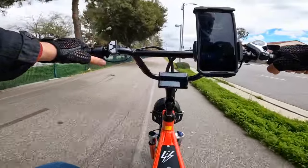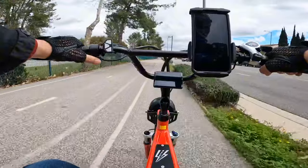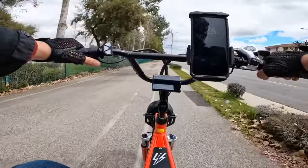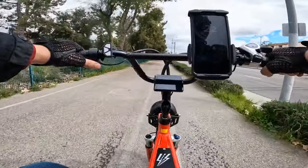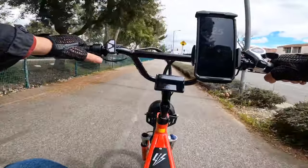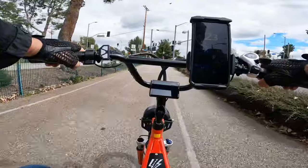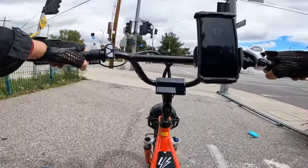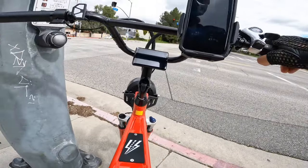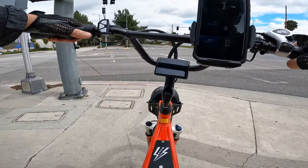If I keep going the same way, the rest of the mileage will be much more efficient than stop-and-go, because every time I stop I need to kick up the power to 850 watts. It takes about 10 seconds to get back to speed, and that takes the most power. When riding in a city — in a car or any vehicle — it's always about 30 to 40 percent more power consumption due to stop-and-go.